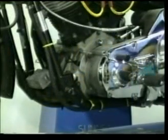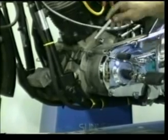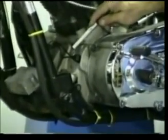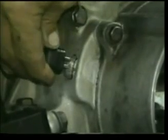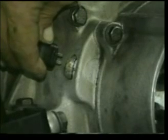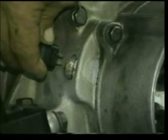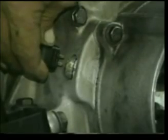The first component of the charging system to be checked is the stator. The stator is located on the left front of your motor. If you have a hold-down clip over the stator plug, loosen up the bolt and move the clip out of the way. After you've done so, carefully remove the stator end plug. We have a two-pin stator plug with this particular model. The earlier shovels employed a four-pin stator — we're going to cover that section right after we finish the procedures for the two-pin stator.